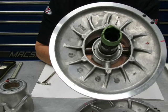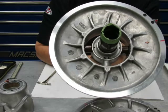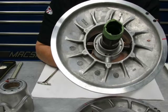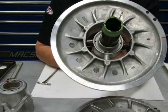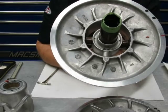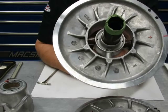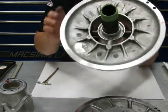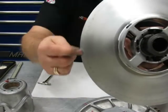I had another one that delaminated of a different brand that was supposed to be far superior, made out of a composite material. Those unwrapped, just like a thin layer of cellophane. I kept finding these little pieces and a thin wrap, and it was actually the roller itself shedding itself and getting smaller and smaller. I found the Skidoo roller works very, very well for the 900, okay? I'd highly recommend it.